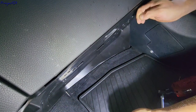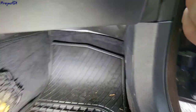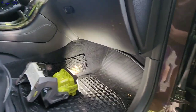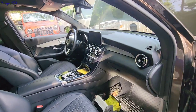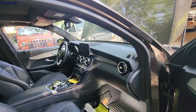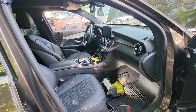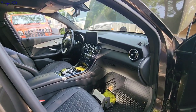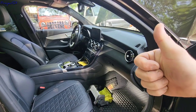That's it — this is the whole job. Fairly easy, not super fast, but that interior filter may give you some trouble. This concludes the cabin filter and dust filter replacement on the 2017 Mercedes GLC 300. Don't forget to change these every 10,000 miles or every two oil changes to prevent bacteria, dust, and bad air from coming in. Thanks for watching — please subscribe and like my videos!